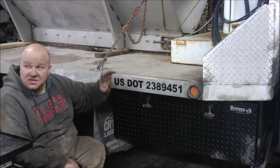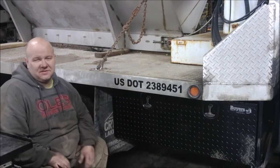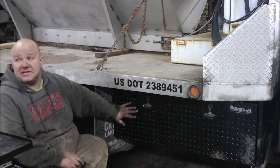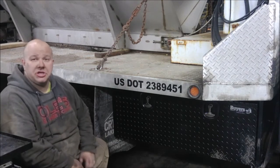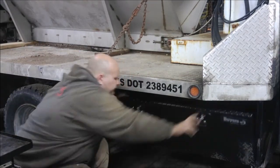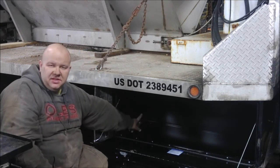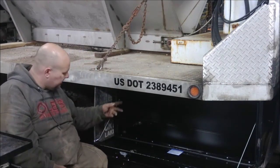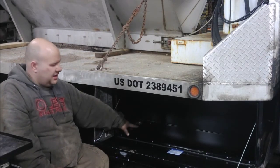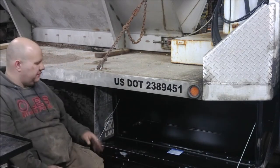I noticed that all boxes are keyed the same — I don't know if that's on purpose, but that's pretty awesome. They send you two keys per lock, so I got eight keys total for this thing. Sturdy, seem to be holding up, they open and close great. All I did was take two bolts, pre-drilled holes in the brackets roughly where it's going to land, and then just up through the bottom, bolted them in. Used half-inch everywhere — half-inch grade 5 bolts with washers on each side, bolted to the frame. I'm not going to step on this because the front door is aluminum — the rest is steel. As I was using my magnetic mud flap, I realized that front door is aluminum. They're nice. They don't have a cross bar so the T-handles can't get out of adjustment — they're individual T-handles. Put them down and they cover the locks. Good stuff.